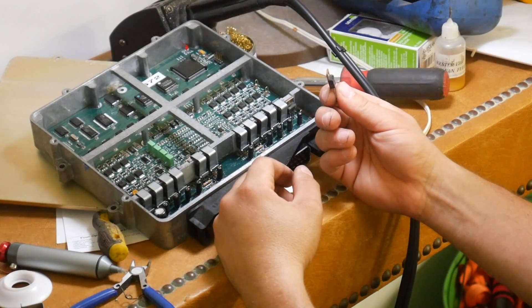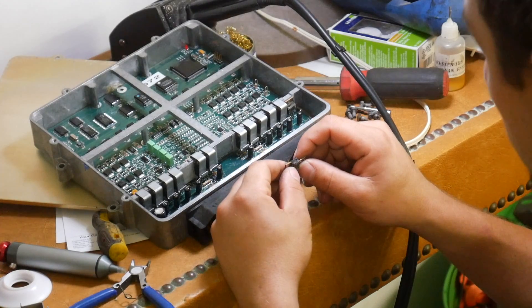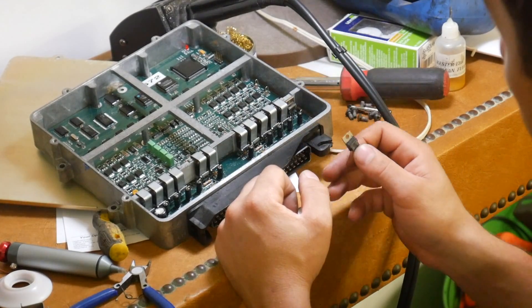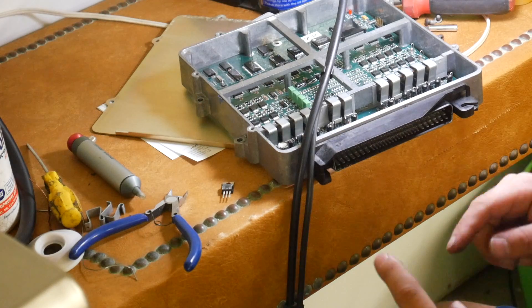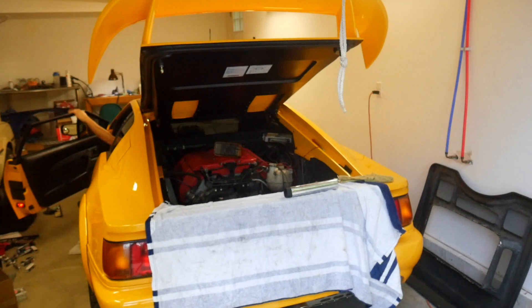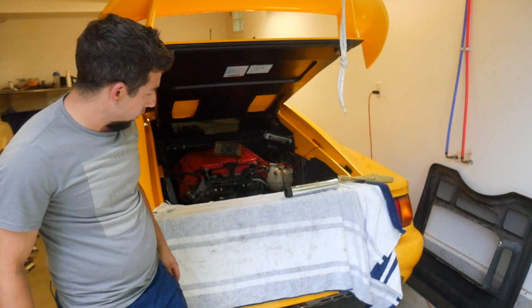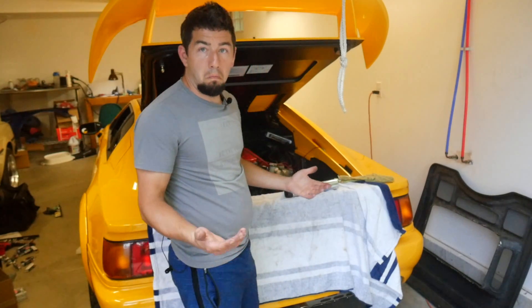With some careful work I was able to get the transistor out — the one I assume is the bad coil driver — and there are no signs of damage. Now we're going to get the good one out, swap their positions, plug the ECU back in the car, and see what happens. Now everything's plugged back in. We're going to start it and see if it runs on six cylinders like it did before. It seems to run okay now — wait, I can hear it missing.